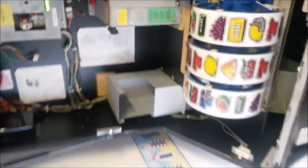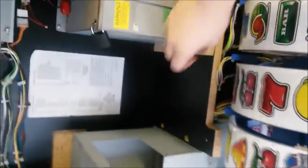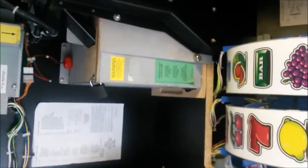So your game will reboot and reload. Now you can either put £350 in your float if you've got it, or just to test that your note reader works, we'll go into refill and we'll just push the top up. So turn the refill key. It still says 350. Warn you, there is now going to be a loud tone. Go to refill, check the refill, 0, the hopper is completely full, it must be 350 float.